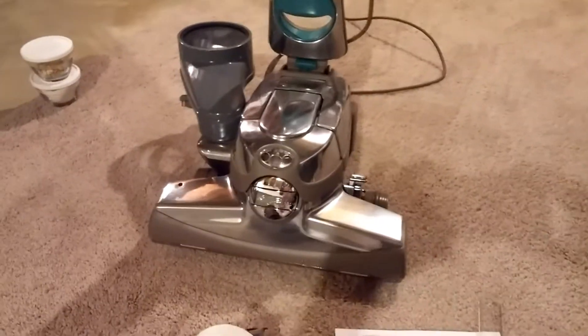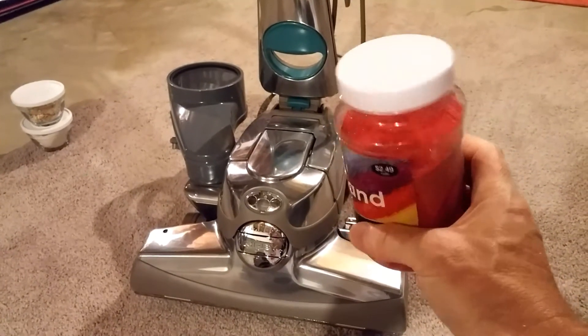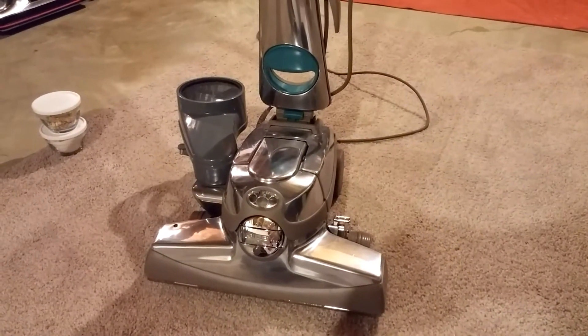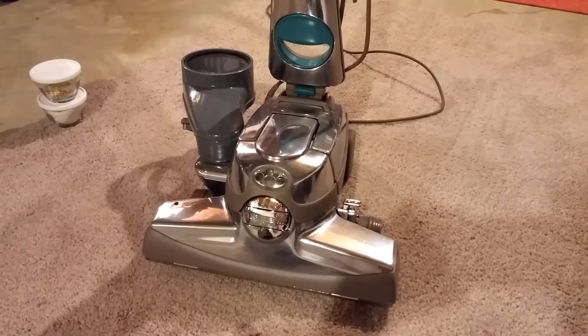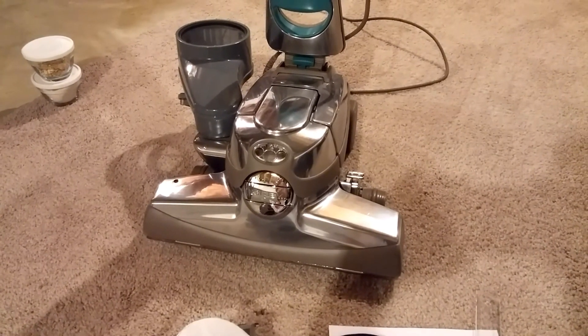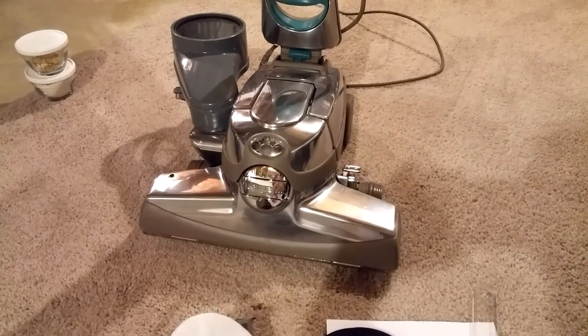Still, 42 millimeters in 10 passes — I'll take it. That's a lot better than the Dyson. So what does this prove conclusively? Does high suction count when picking up? This isn't bowling balls — this is fine sand, so it still qualifies as fine dirt, but it's heavy and very dense, not your normal carpet dirt. So at 16mm versus 42mm, you're talking about two and a half times more pickup. The DC65 had about 52 CFM, this one has about 137 — isn't that about two and a half times? I wonder if the two things are connected: higher airflow, better pickup. Like, comment, and subscribe!